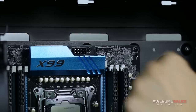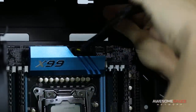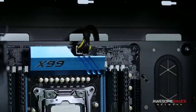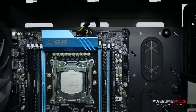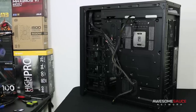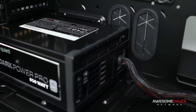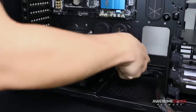That's why I usually get the 8-pin cable routed in first. Plug the 8-pin cable into the motherboard and route the rest of it through the nearest routing hole — most cases have a hole or two at the very top above the motherboard. As a rule of thumb, you always want the cable to travel the shortest distance possible between its connector and a routing hole. Using routing holes hides the bulk of cabling behind the motherboard tray. Cases often have a routing hole next to the power supply as well, so thread the other end through that opening and connect it to your power supply.